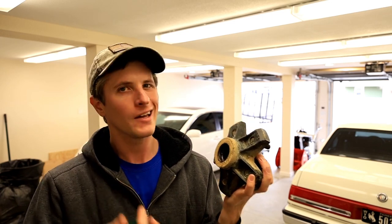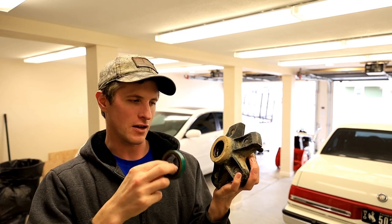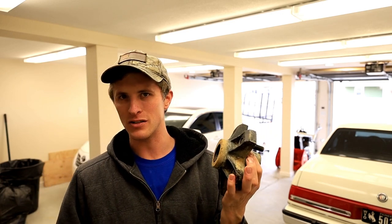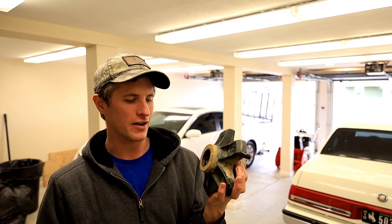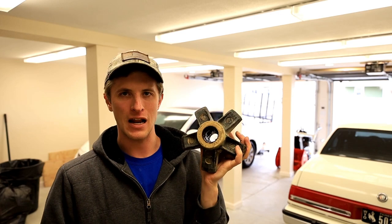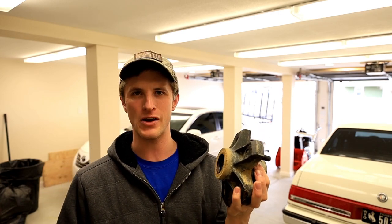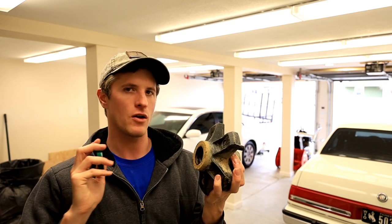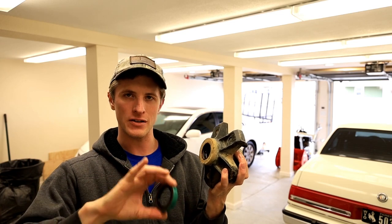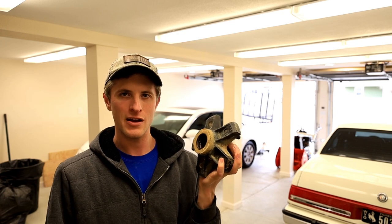I went over to NAPA, not a sponsor, and on the shelf, because this is a normal trailer without a specialty axle, they pretty much stock the parts that you need. They're pretty generic as far as that's concerned. You're going to destroy this seal getting it out of the hub. The OEM one is like welded in there. Don't even try to salvage it. So always get your number off the seal and obtain a replacement before you destroy your older one.